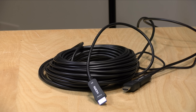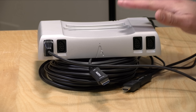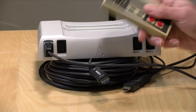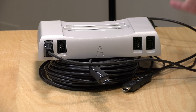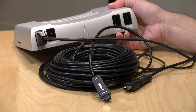I tested input lag on the cable with my Analogue Nt Mini NES clone console — this is the lowest lag device I own, for a number of reasons: it's powered by an FPGA processor and its controllers connect with NES controller ports that don't have to go through a USB interface first. So there's very little input lag coming out of this device. What I do is take out my iPad, shoot the screen at 240 frames per second, push a button on the controller, and see how long it takes for that button push to register on screen. It's not a perfectly scientific approach, but it gives you a good baseline to compare one cable solution to another.